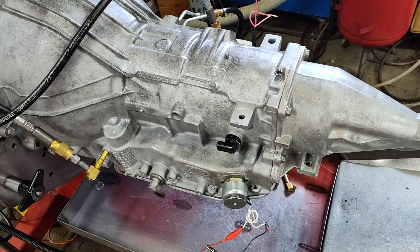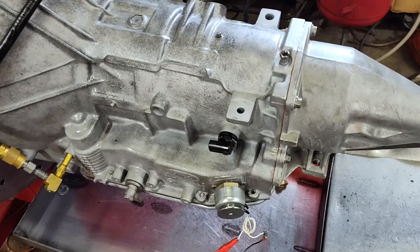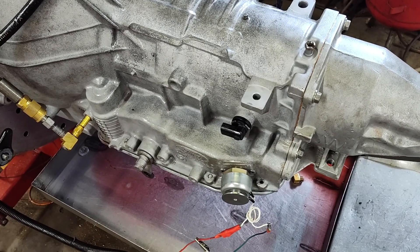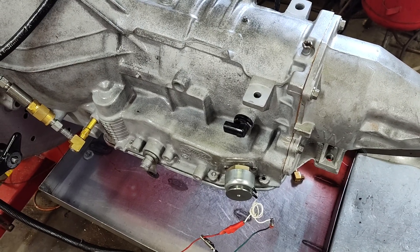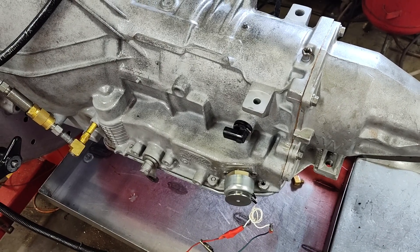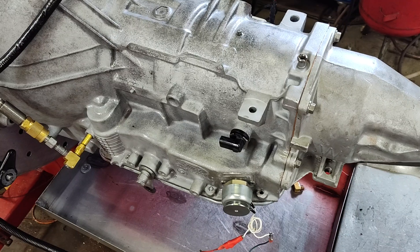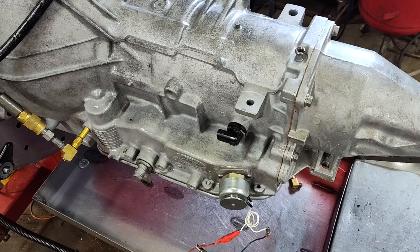What we've got here is a Ford 4R70W. Traditionally, if these had a trans brake the solenoid was internal, and a lot of times they were a small solenoid. Some of them suffered pretty badly from a massive delay when you go to leave. Also, it was difficult to service those little valves — those small solenoids. You typically have a really small hole that feeds them and that hole could easily get blocked and they could be temperamental.